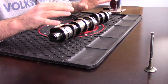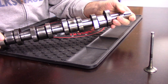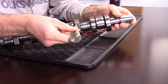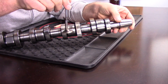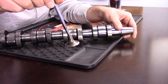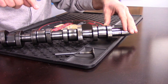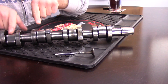Let's start off by talking about what a camshaft is. The camshaft is part of the valve train, and as it rotates, these lobes will push a valve in and out. As the valve opens and closes, that either lets air into the engine, prevents air from leaving, or opens on the exhaust side to let air out. On a camshaft like this one, there are also lobes that open and close the fuel injectors.